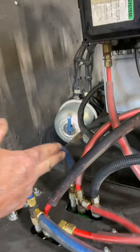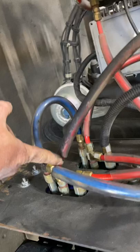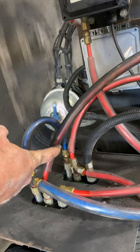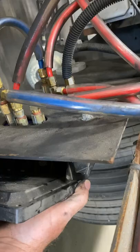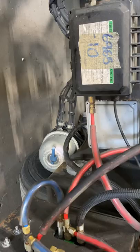Both of your centers — that one and your center one here — those are whenever you push the button in on the tractor, you supply air. That's what pops the valves out. In case the customer does not pull them out, they release their air, it pops those buttons out, resets the valves, that's the trailer go up, and it also sets the slider pins out.